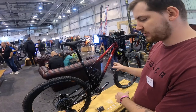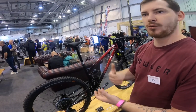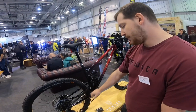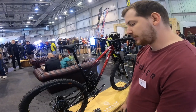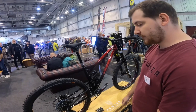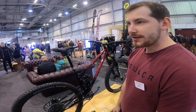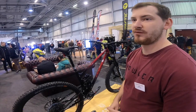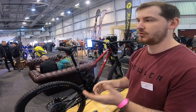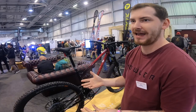What's the tube set? On this prototype it's basically 4130 chromoly, plain-gauge, just because it's a prototype — we didn't want to go full hog on butted tubing and all that yet. The chainstays are Tange Champion because they've got really nice bend to them and give good clearances. When should people get in touch to get on the build list? Get in touch now so I can keep you informed on progress — I'm hoping early summer, but we need to do some intensive testing and make sure it's right before we bring it to market.